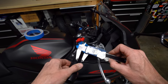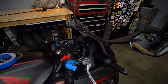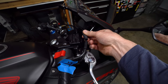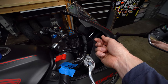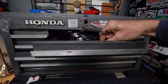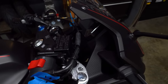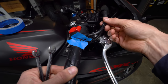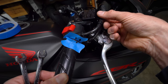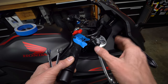Clearly we need to take some slack out here. If your motorcycle has a two-cable setup — which most of them do — it's called a push-pull throttle, and it's going to be the upper or forward cable that has the adjuster on it. Push the little rubber cover back and you'll see a barrel adjuster with a lock nut — looks like we need a 10mm and an 8mm wrench. Taking the slack out is as easy as cracking the lock nut free and moving the barrel adjuster. If I push back to the tension point and dial it back, you can see the reference line moving forward. That's basically zero free play, which can be a little risky — we'll explain that in the final step.